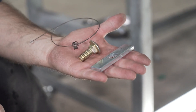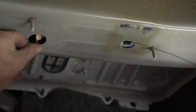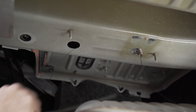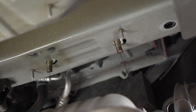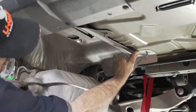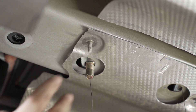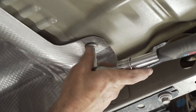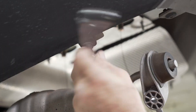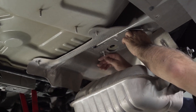You can now fish wire in your hardware using the fishing wire, the carriage bolt, and the carriage spacer. You can now raise your heat shield back into place. This heat shield fastener will not be returned — the hitch will sandwich it into place. Now repeat for the other side.